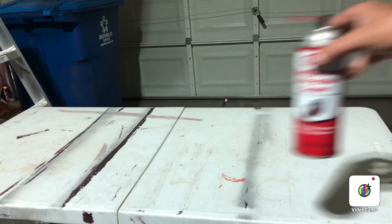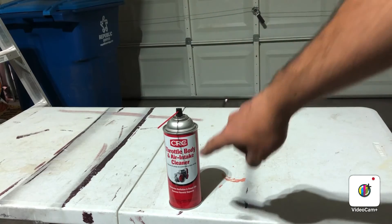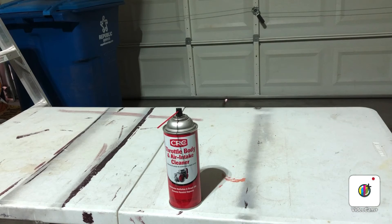Lastly, look at your air filter. If the air filter is dirty when it's hot out, you're not getting proper airflow — your car runs on an air-fuel mixture. If you start seeing black smoke, it could be a dirty air filter. Follow the intake tube from the air filter to the engine; it unscrews with one screw. You can spray some throttle body cleaner in there and clean out your intake after you've changed the air filter.